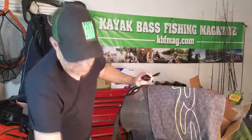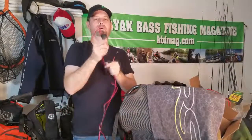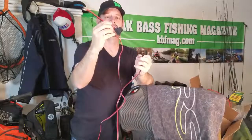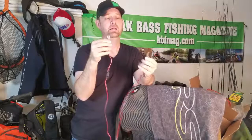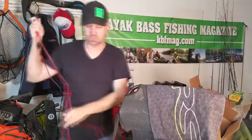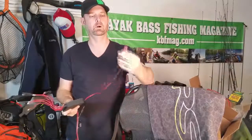You've got to power this thing, so how do we power it? A lot of guys struggle with building an inline fuse and spade connectors and doing all of that work. Well, Yak Power actually has you covered on that. You've got an inline fuse on the positive and connectors that will plug into those spade ends on a deer feeder battery — typically 7.5 amp hour, 8 amp hour, 12 volt. This just plugs inline to the switch and you're good to go. If you're using the big switcher box, it's actually labeled for power — it's a red plug instead of a black plug so you can see the difference. This is your power.